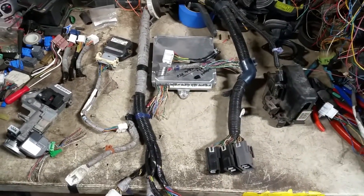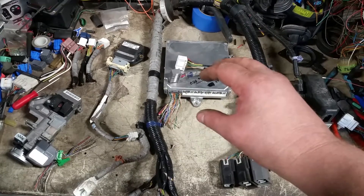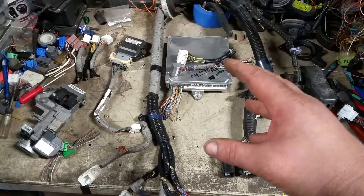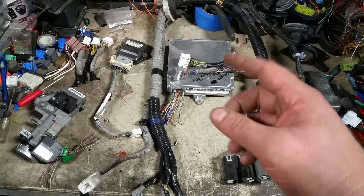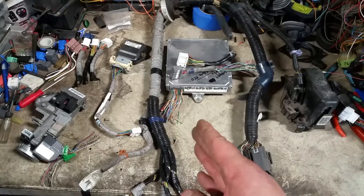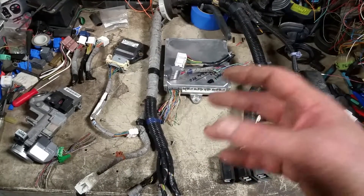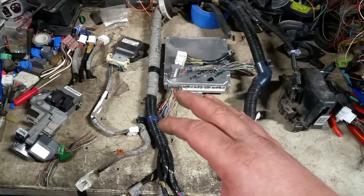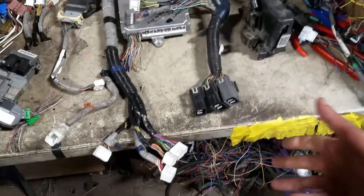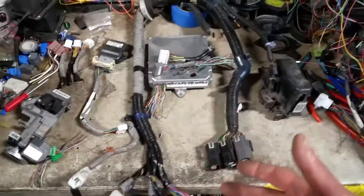There are different things depending on your setup. If it's an auto ECU and it's '07 to '08, it can be reflashed with Flash Pro. If it's already a manual ECU, for '07 to '08 you can use K-Tuner or Flash Pro. '04 to '05 is its own wiring and ECU, '06 is by itself, and '07-'08 has its own path. If you do something with the '04-'05 now and want to upgrade later, we can make you an adapter to plug into a sub harness so you'd be able to use the '07-'08, or the Haltech ECU, or the Infinity ECU — those all work very well.